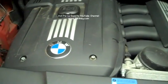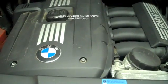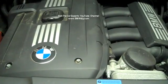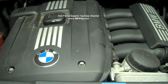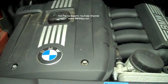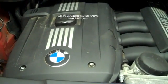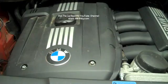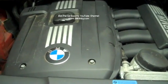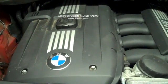I've seen quite a few problems with Vanos solenoids. I've seen them cause idle issues just after a cold start, putting the vehicle into reverse or drive. I've also seen stalling issues where the vehicle won't even start. It will crank and not start, or it will crank and catch and stumble and stall. I've even had that happen without any fault codes. Some typical fault codes are for Vanos sticking, like P2A82 and P2A99, or P1554.